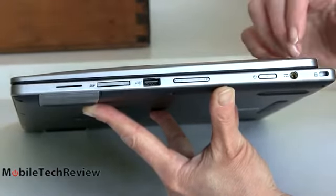As you can see here, we have an Intel Core i5 3337U CPU. That's the refresh of the 3rd generation Ivy Bridge CPU, so it's running at 1.8 gigahertz. A good performer there. So though this is a 15-inch notebook, you're not getting a full mobile CPU, you're getting the Ultrabook version. The good news for that is it's relatively cool, it's relatively quiet, and battery life is decent despite the fact that it's fairly thin and it doesn't have a very large battery inside.